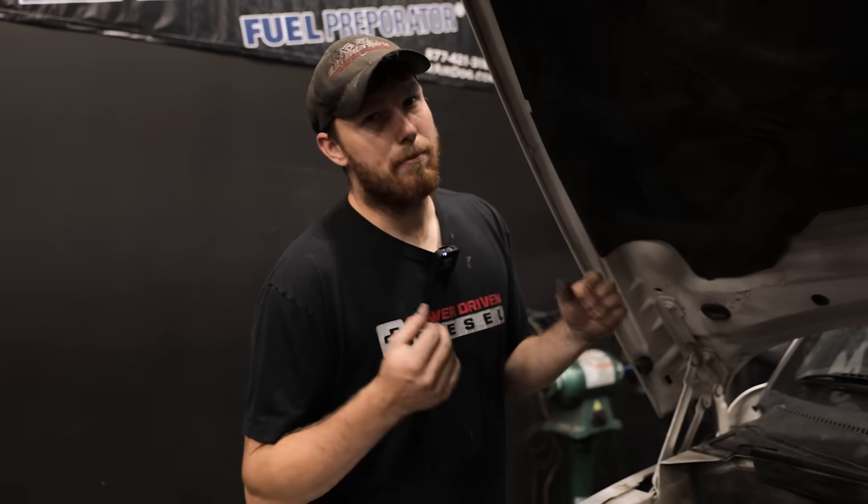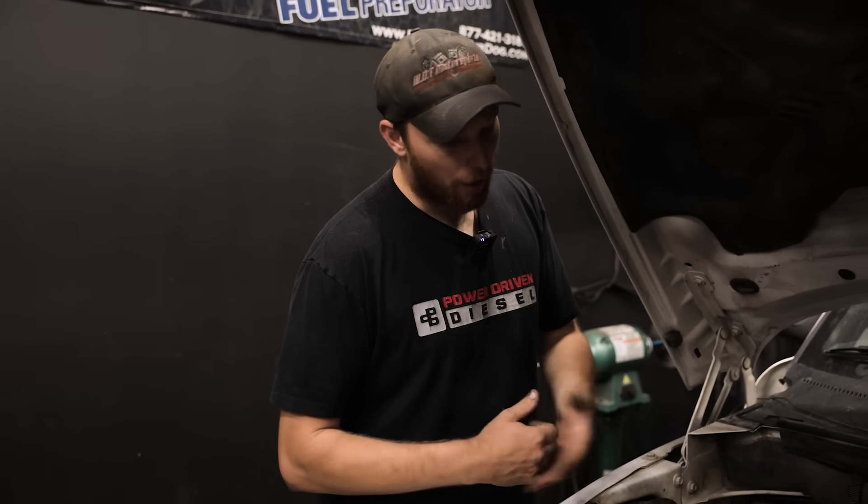We made 327 horsepower, EGTs hit 1400, and that was 18 pounds of boost. So I'm gonna try tightening up that gate a little bit and see if we can make the HY act a little bit better, just because the HX is going to be able to put a boost elbow on it to get that boost up. On these HY35s — really on any other turbo — you put a boost elbow or some other boost control device on there and it works. But these HYs are hard-piped onto the wastegate actuator, so there's no doing that.